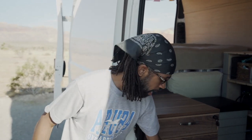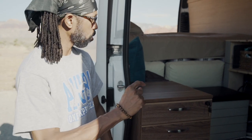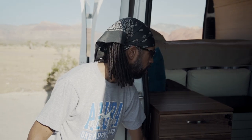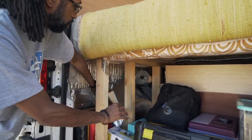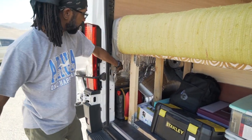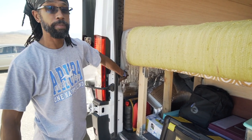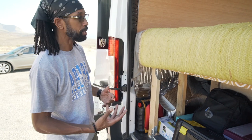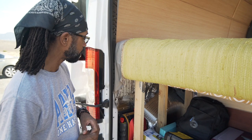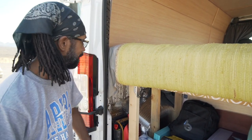The first thing I did with the van is I added flooring — a premium vinyl flooring with a quarter-inch wood underbase to make it solid, then sealed that off. I also have what's called Reflectix, which is the outer layer that creates a one-inch gap for a heat barrier. Inside of that, up against the metal wall, is denim insulation made out of ground-up denim jeans, so it's a cotton base. It keeps moisture out and absorbs heat along with the Reflectix as a heat shield.